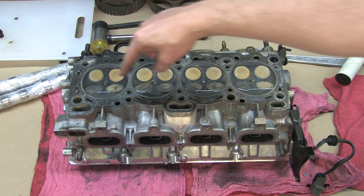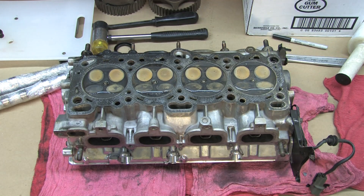Very minor stuff. You can look at the meniscus on top and tell they've all dropped roughly the same amount. Nothing is just dumping out. I've never had any problems with compression on this engine — it always hit right around 150 to 152 pounds. I know that seems low, but it has cams in it and I always ran factory cam gears, so they really weren't properly degreed. I should have had adjustable cam gears to really get any benefit out of them. So that's the intake side. I'm going to take a look at the exhaust side now.